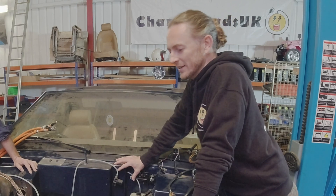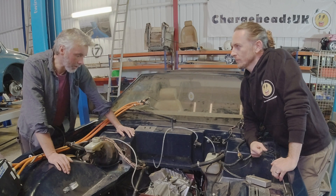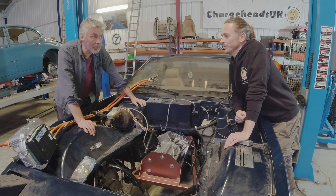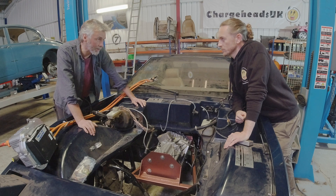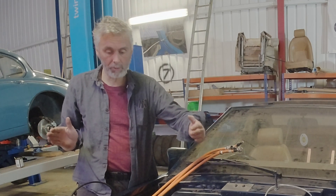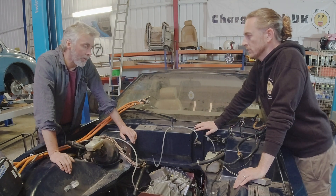My life insurance isn't very good so I don't think I'll ever get close to that. Have you worked out the 0-60? It does depend on the total weight of the vehicle, so we've made some assumptions, and the tires are absolutely crucial. How well the suspension works matters too, and one of the difficulties with this chassis is the rear suspension isn't very good. We're going to enhance it — we can adjust some of the links and the bushes to try and make the back wheels point in the right direction more of the time, because they have a tendency under hard acceleration to start pointing the wrong way.